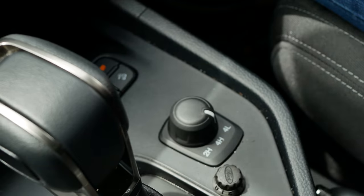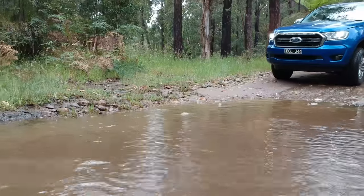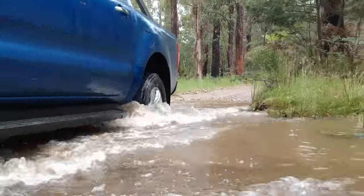In this Ford Ranger, we're using second gear in the low range. This will help us keep smooth and steady, not going too quickly through the water. You want to keep the speed as nice and steady as possible. If you see any obstacles, try and avoid them. And if it's muddy, keep momentum up so as to keep moving across.